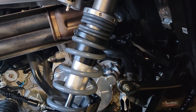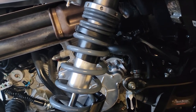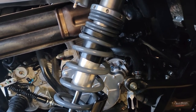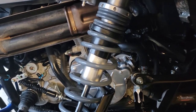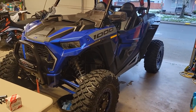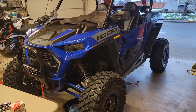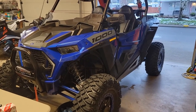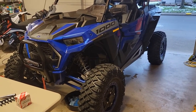We're above the add mark and below the overfill, so we're at a good spot, with the engine cold as per Polaris directions. Look for leaks underneath the machine and check the filter area. For what it's worth, I did need to add a little more oil — I put in two and a half quarts but needed just a fraction more, maybe another quarter quart, to get it in the correct range. I hope that helps and gives you confidence to change your own Razer oil. Like and subscribe — I'll be covering clutch cleaning, front and rear diff fluid, and working through the machine step by step. These Razers are super easy to work on.